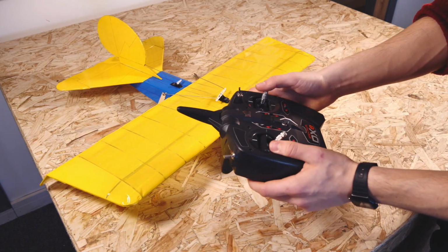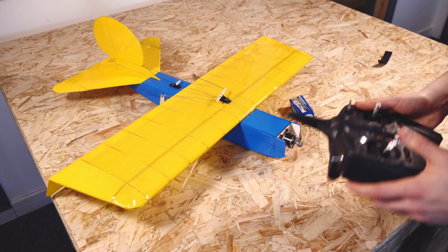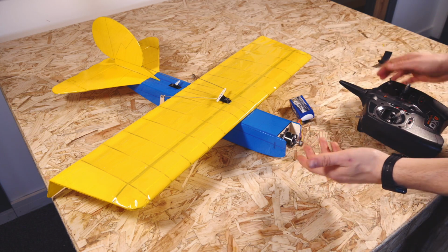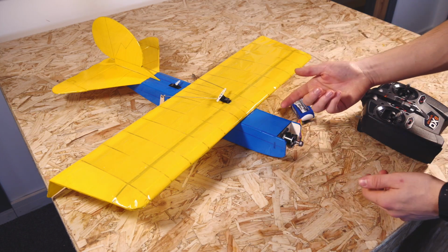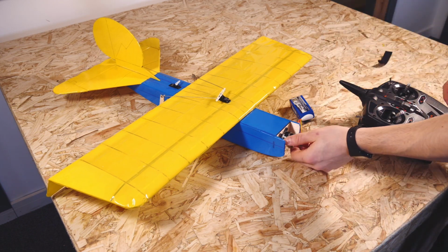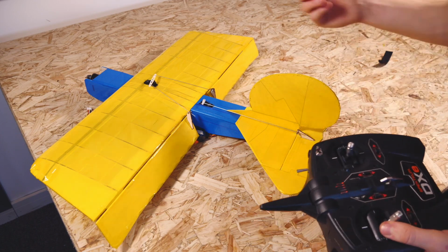the aileron servo works to an extent, even though obviously you've not hooked those up properly yet. The motor works. If it spins the wrong way, you need to switch out the bullet connectors as mentioned before and as mentioned in the setup electronics video. And the elevator should be working as well, or at least the servo.